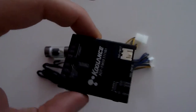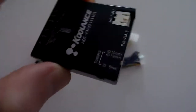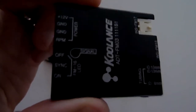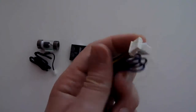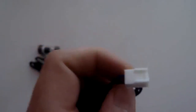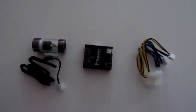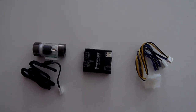Now the power adapter — the ADT-FM03. On the right you can set the tubing size. You have two different connectors for two different models of flow meter. On the left you have the power connector, and you can also set the signal synchronization. So basically you plug the flow meter to the power adapter, this connector goes to your motherboard fan header, and this one to your power supply. This way you can read the flow as RPM from the signal, where the RPM reading represents approximate coolant flow rate in milliliters per minute.